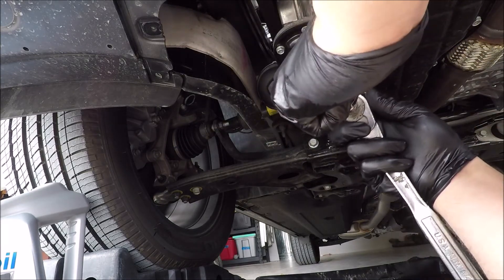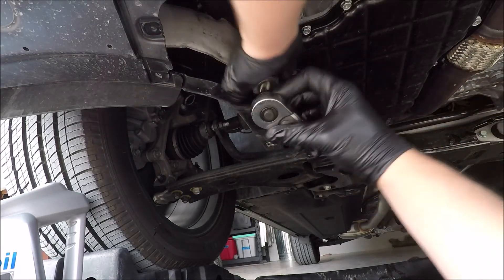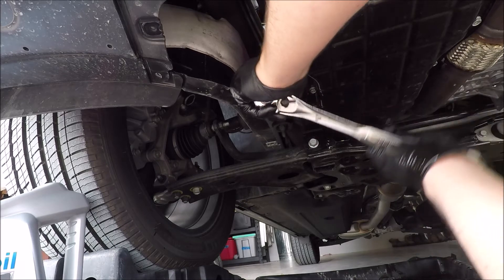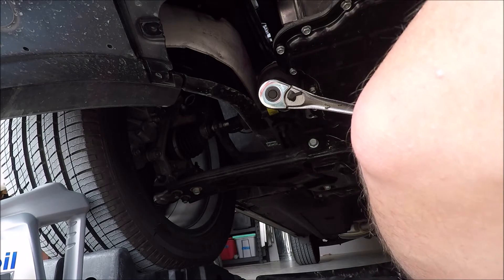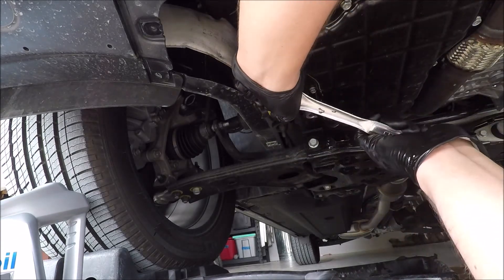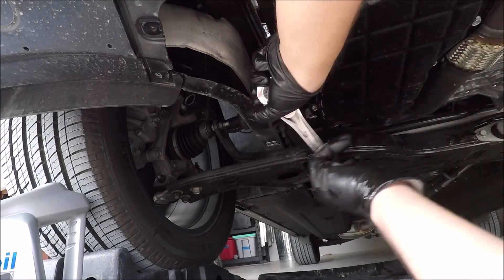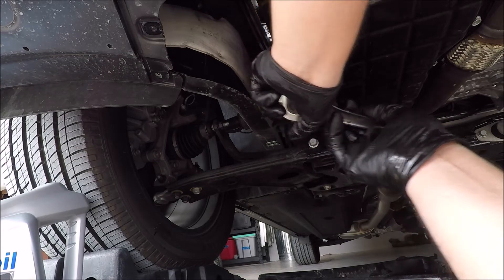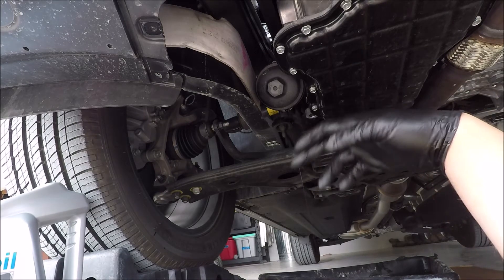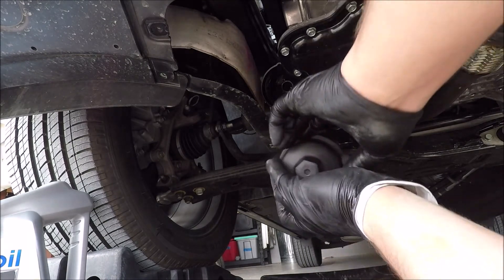With the oil almost completely drained, let's focus on the oil filter cartridge. I've got a one and one-sixteenth inch socket — we want to loosen this, so lefty-loosey. There is a torque spec the manual recommends, though the manual doesn't actually show you how to change the oil — it just says go to the dealer. The semi-coarse threading is plastic on plastic, which I absolutely hate. We've got a little drip going — this cartridge casing is tapered with a drip channel in it.